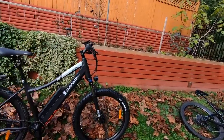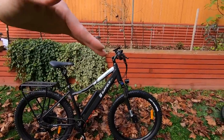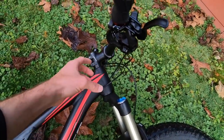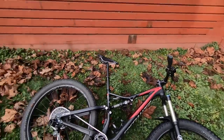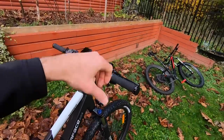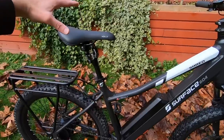What makes the Shred a little less aggressive than the Specialized isn't just the suspension — it's the geometry. The steering tube is a bit longer and higher, with a 45-degree 90-millimeter stem that brings the handlebar up so you're much more upright and comfortable. On the Specialized you're leaning forward, pointed downhill, and it has a dropper seat post, a very straight short stem, and a more aggressive geometry with a lower standover height. For a bike that's meant for getting around town and some trail riding, the Shred's upright position is perfect, and you could even swap to a lower-rise handlebar. It comes in two sizes: 19-inch and 17.5-inch.